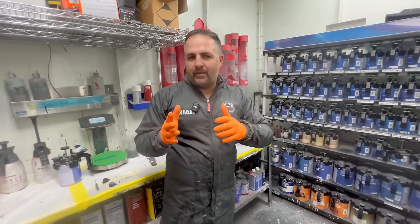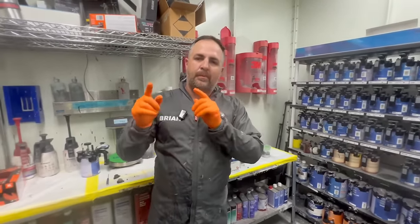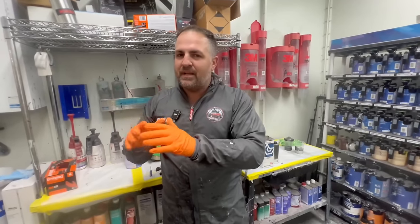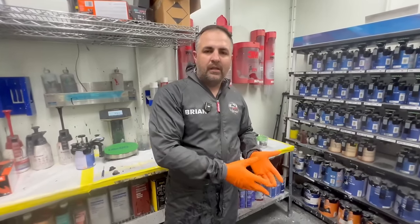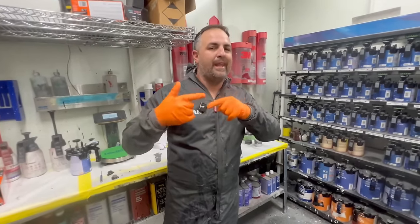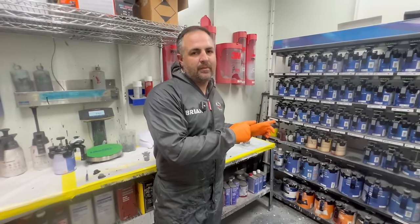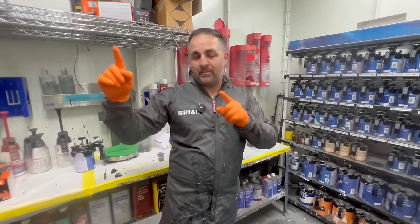And the thing with these sealers, sometimes you got to be careful with, is it will give you a false impression that your color is covered, especially on blues or reds. So sometimes using that gray sealer or the olive color sealer for like a red, it's going to help you know, hey, it is covered. Still a great addition to this system with Sikkens and Lesonal. Let's let that flash. Let's mix up the paint now.